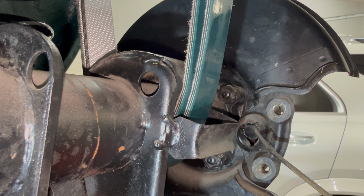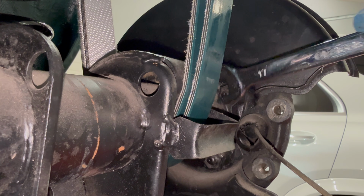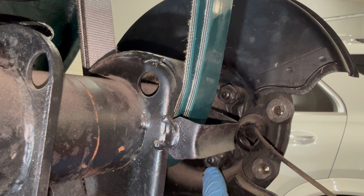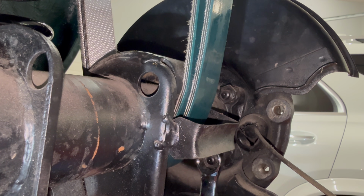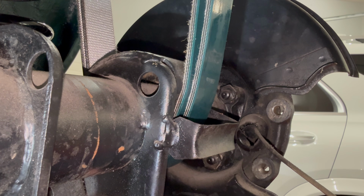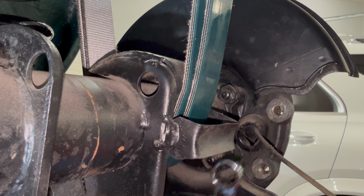All right, so we're at the back side of the wheel hub. This is, of course, where the disc brakes will be. As you can see, using the wrench, there are these really thin nuts that are basically lock nuts. They're almost made out of tin, so you've got to be careful not to overtighten them. We've got to remove those first. There's four, of course, and you can only see two of the four nuts, the other two are on the front side. Once those locking nuts come off, we'll be able to take off the hub nuts themselves, and then slide out the hub assembly and the axles. So we'll get those done.